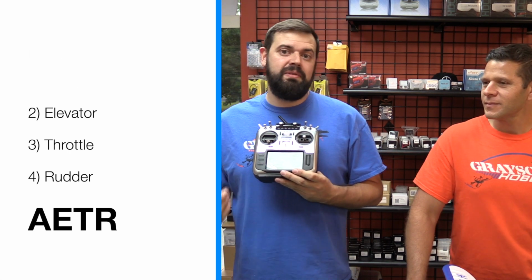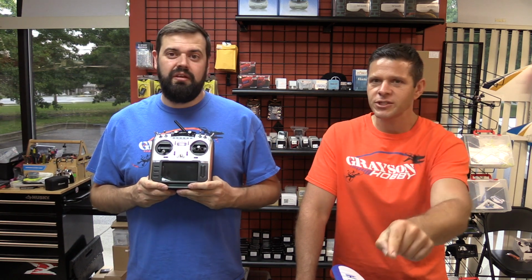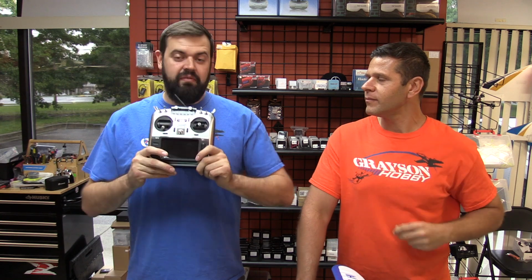If you do not set it up in that channel mapping, it will be all sorts of screwed up, and you run the risk of having the motor go full throttle by accident and somebody getting hurt. That will happen. But don't worry, if that didn't make sense or you didn't follow, we definitely show you this in detail coming up.